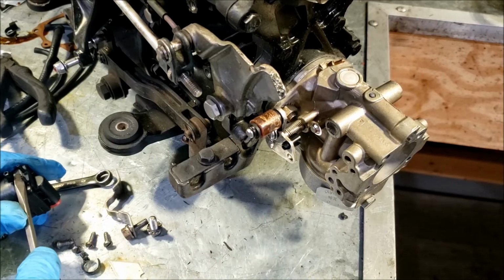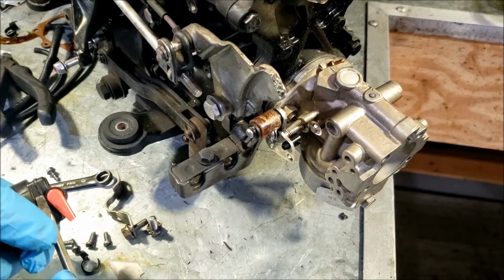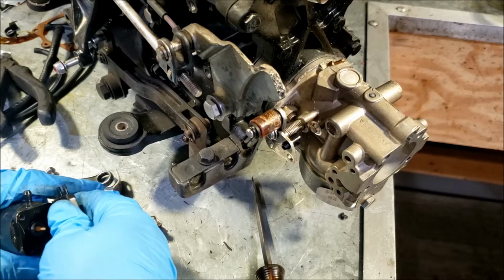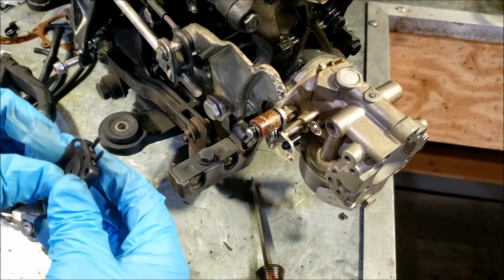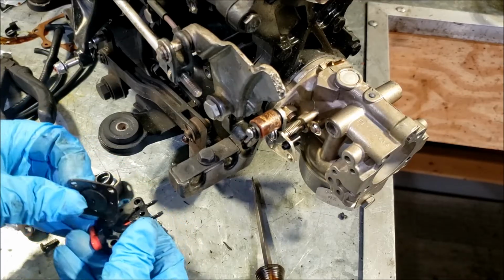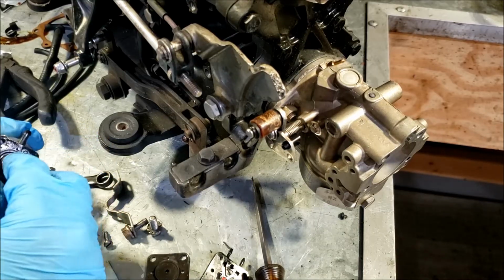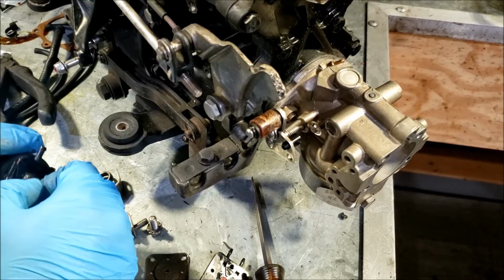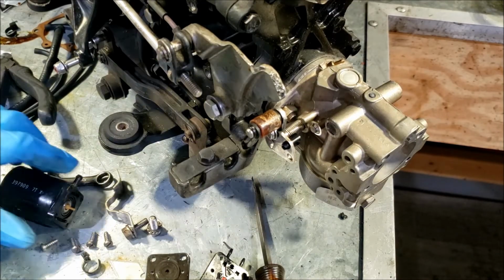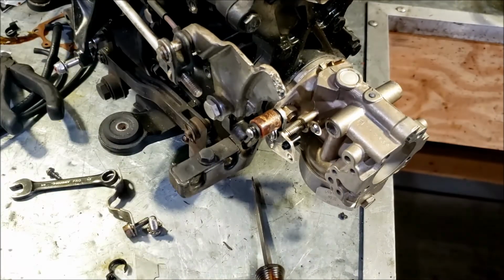Pretty tight. Those are going to break. Gasket looks okay. Our top cap didn't break. It's pretty stuck in there. But gasket looks fine. Valve looks fine. The plunger is stuck. So it's a good thing we took it apart. So, into the carburetor cleaner bucket for this, and it's lunchtime.